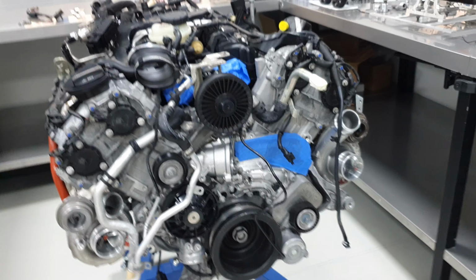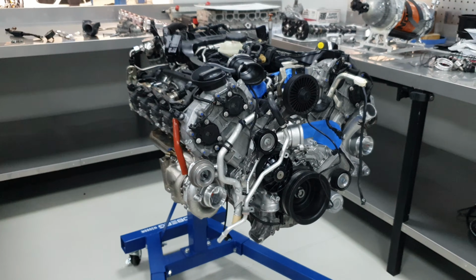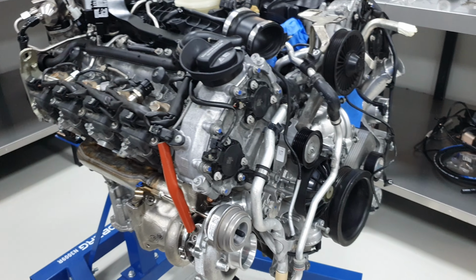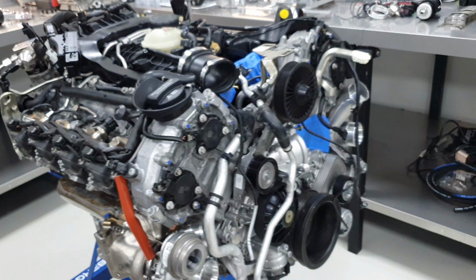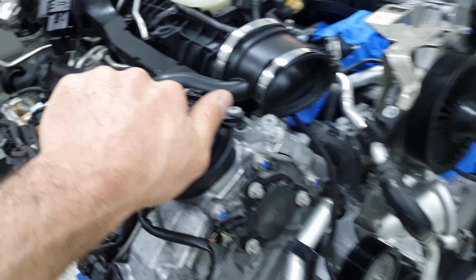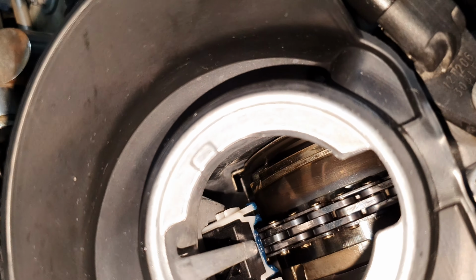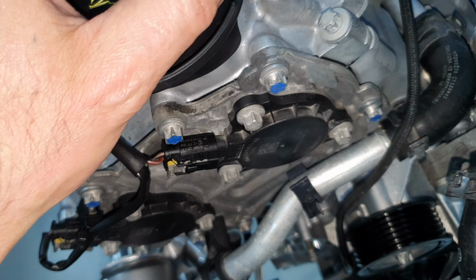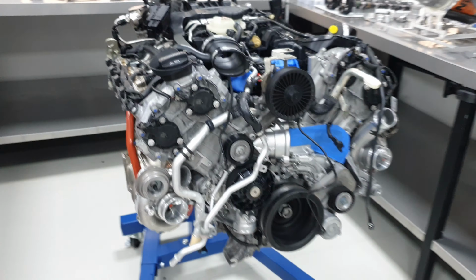You'll have the same thing like any other time. Same setup, actually. No difference there. It's going to sound like you threw stones inside at the first start, because the cam adjusters are empty, the camshaft is empty, the hydraulic lifters are empty. It also has assembly grease, but I'm putting it on all the time. This one over there, I'm talking about. That's it, over and out.